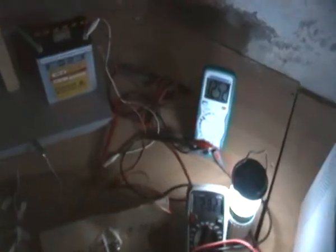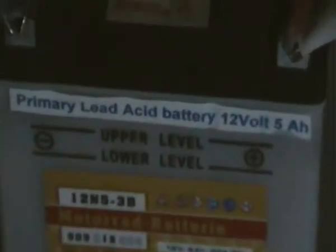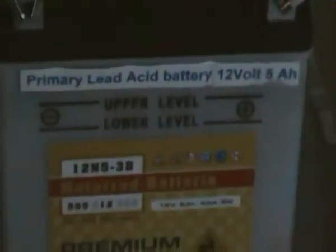And okay, what is interesting about my primary battery is this voltage, because when I charge the primary battery with a conventional charger device, the level of the liquid didn't change. It was interesting to see. So it's very important to monitor the liquid state in the battery. If you see that you're below the level, just fill up the battery with distilled water.